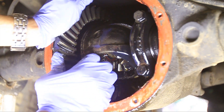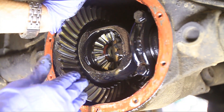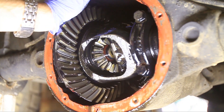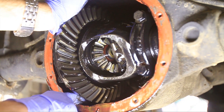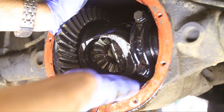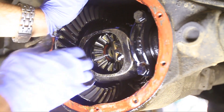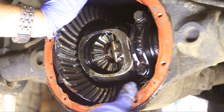Now while you're in here, you want to check for damage. Put the car in neutral and you should be able to spin everything around. Check your ring gear for missing or broken teeth, also your pinion gear which is back behind here, and all of your spider gears. You also want to put your finger down and pull some oil from the bottom. A lot of times there's a little pocket in some of these axles — dig around in there and check for metal shavings. If you have big chunks of metal, that's really bad. Little shavings will look like silver paint inside the oil, and that could be bad too — it means something is getting chewed up. But everything looks good on this one; the oil is nice and clean.